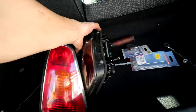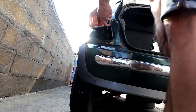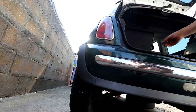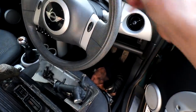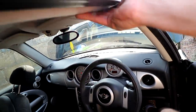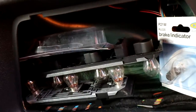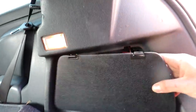Let's go ahead and stick these nice shiny new ones in. With the battery hooked up, it's worth checking that all the lights work - hazards work, side lights work. I'll just assume the brake lights work as well since there's no way of checking on my own. I'm going to stick the two 10mm bolts in and get everything buttoned up. I've stored all the spare bulbs from the lights I got tucked away in the little cubby hole just in case they're ever needed.